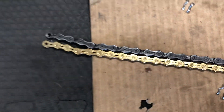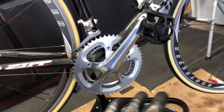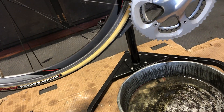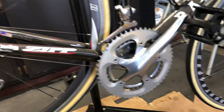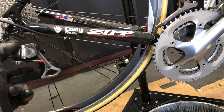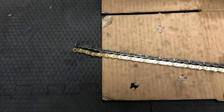So this is how you actually change and measure a chain. First, I took it off the bike. Before you do that, you're supposed to shift it into the big-big gear. Make sure the chain wasn't already too short — someone had previously installed one too short. You want the derailleur to sit right; when it's in big-big, if the chain is a touch too short, you could add one link. Then put it in small-small and make sure the chain isn't rubbing on itself.